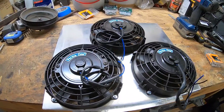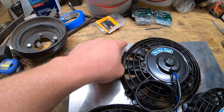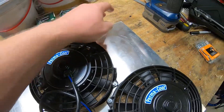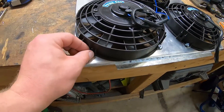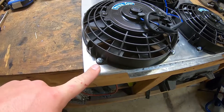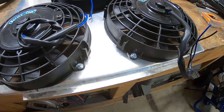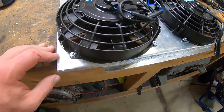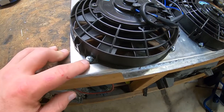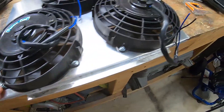I need to get this put over on the radiator and then drill holes for all of the screws we'll be using to mount it. I'm probably going to change out these nuts a little later on — these are not jam nuts or nylock nuts or anything, so I have a feeling they're going to unthread themselves. So maybe some Loctite, or I'll probably just go get some nylock nuts.